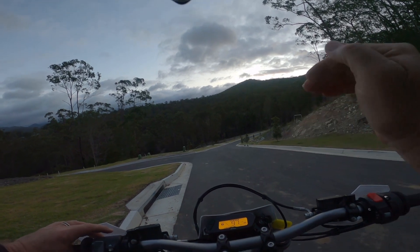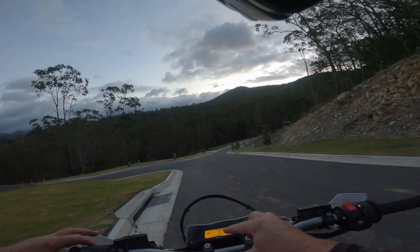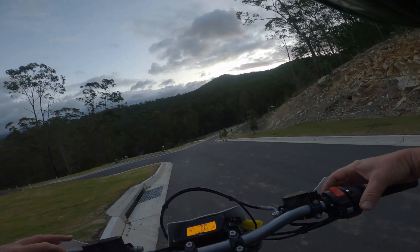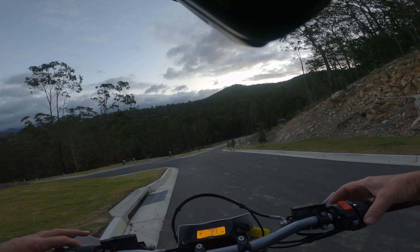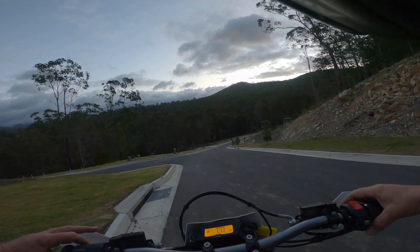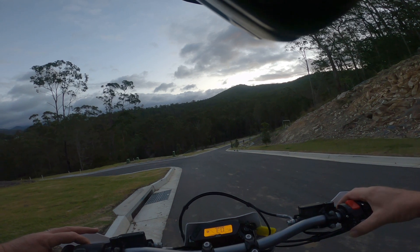Coast mode is when you back off to zero throttle — the level will dictate how much regen you get in your coasting. Like a four-stroke, when you back off, it will want to stop you. So we're in the brake mode. If I hit this right-hand ready button, it will toggle me up. I'm going to put that up to five — I like a lot of regen. Then I'll hit the left-hand button to take me to the coast mode, and I can take that up to five as well.